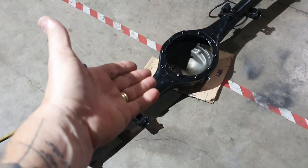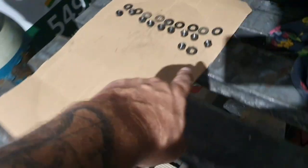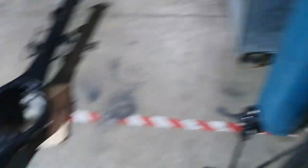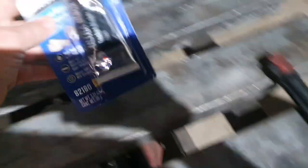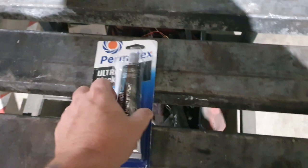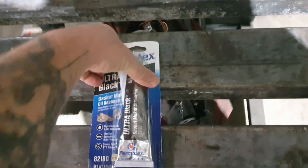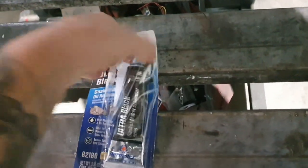The diff housing is perfectly clean and ready for reassembly. Just got to blow a little air through it since it's been sitting for a few days. I've laid all the original nuts and washers out — I have 10 of those and 10 studs. There is our diff centre looking particularly good. I'm going to be using this gasket maker instead of a gasket because everyone told me a gasket's a bad idea, and they can be prone to leaking. We're going straight with the gasket maker on this one, hopefully that seals it up good and she ain't coming out again.